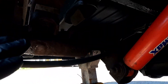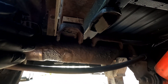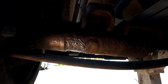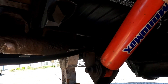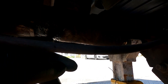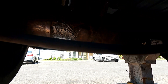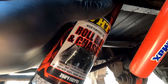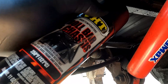When the bracket does rot and rust away to a certain extent, you'll start to develop a pinhole where it actually makes it through to the inner axle tube. That's going to cause you to lose axle fluid — gear fluid — out of the differential from the tube itself. I dropped my truck off to get it fixed. I figured, clean it up, wire wheel it off, put some tack welds in that spot, done deal. But the guy was really busy so I had to get the truck back, because this is my daily driver, and I had to take matters into my own hands.